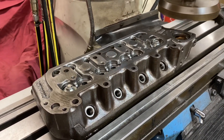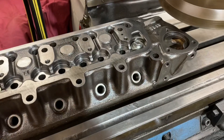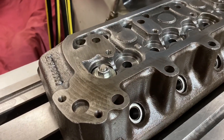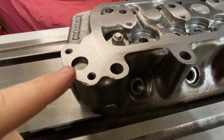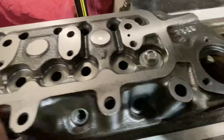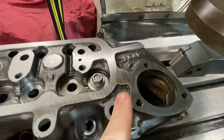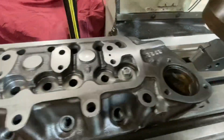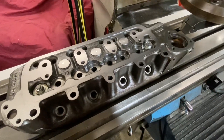Here we've got the cylinder head up on the milling machine and we're now going to skim the top face to make it nice and flat and get rid of that horrible original factory machining. On the first pass we can see it's not quite cleaned up all the way across — the original surface wasn't quite flat. This end hasn't even been touched at all, so yes it's touched most of it but just not this corner. We're going to keep machining to get it nice and flat.